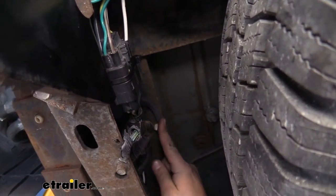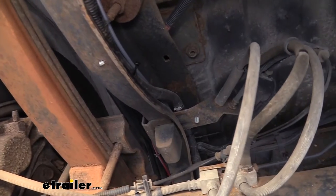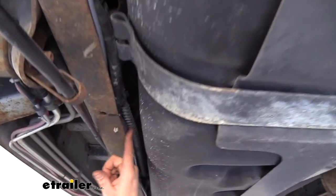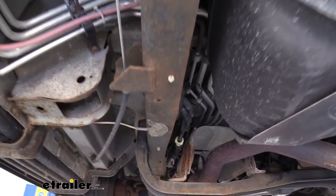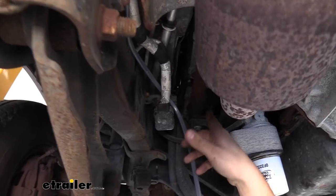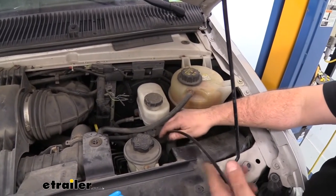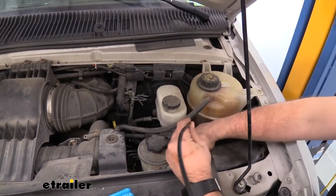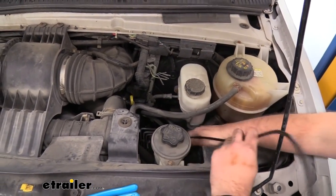I just tried to stay along the frame rail, following a lot of the existing wire loom — that's going to protect those wires and keep them from being in contact with anything that's hot or moving. You can see I just kind of went along the frame rail, zip tying it to the existing wire loom, and then made our way past the heat shield up to where the engine bay is. To get our wires pulled up to tie into the battery I'm using a little bit of spare airline tube. If you don't have anything like that at home you can use a long stick — basically just feed it in there, tape your wires on it, and fish them up.